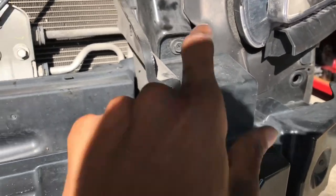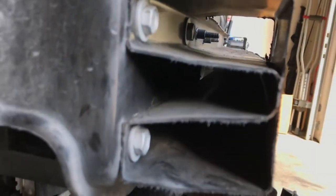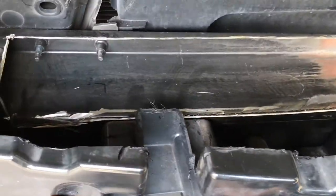So here's what I ended up doing — I took those plastic pieces off, I just cut them with a regular knife. I'll trim them up better later. I ended up having to cut the crash bar. The fit was kind of close to the bumper otherwise. I noticed on the side it's kind of layered — like a multi-layer crash bar — so what I did was trim down just this front plate to the middle plate. I essentially just took this layer off and got it down to the second layer, and that gives me the gap for the heat exchanger to sit right here, leaning back a little bit. I did the same thing with the plastic cover — trimmed it just a little bit. The heat exchanger will clear.